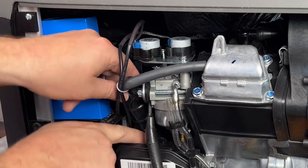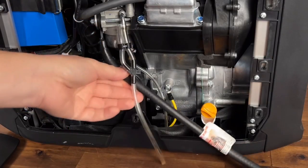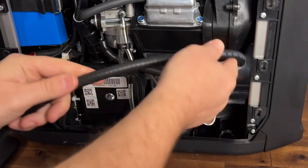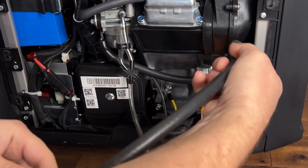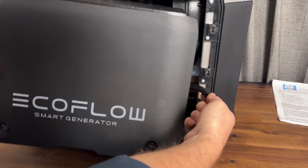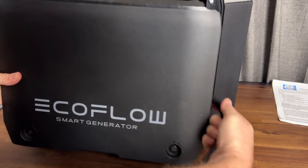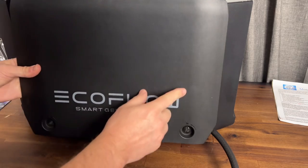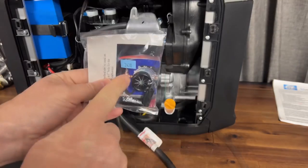Reinstall the battery and make sure you get the tube back on top of the valve cover, then move on to the next step. This next part is a little bit of personal preference — we have to route the hose. I'm going to put it over to the edge, make sure it's above the oil filler and not touching the engine. I'll line it up right above the W on the EcoFlow logo.